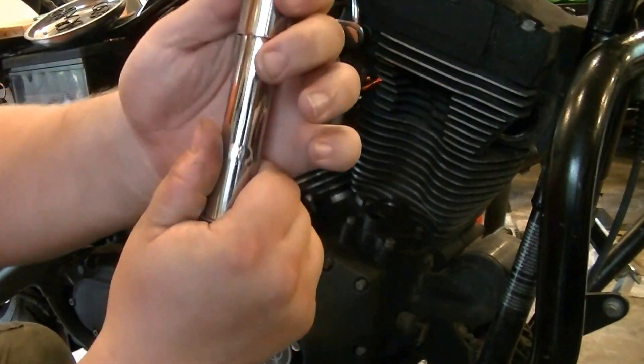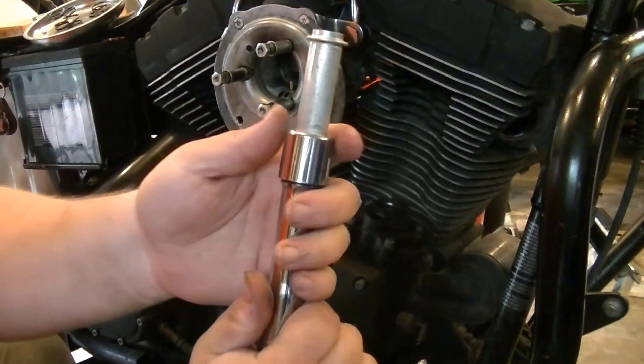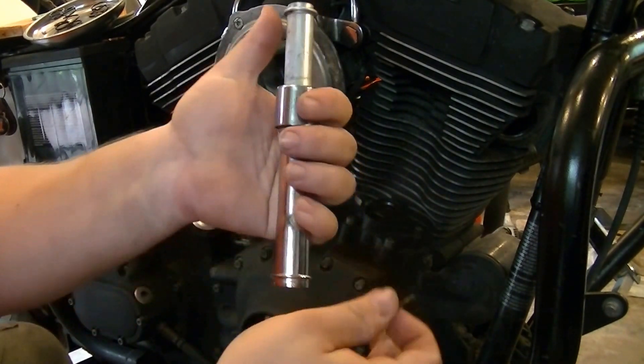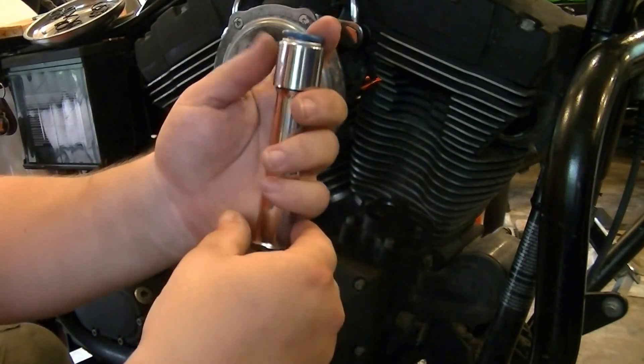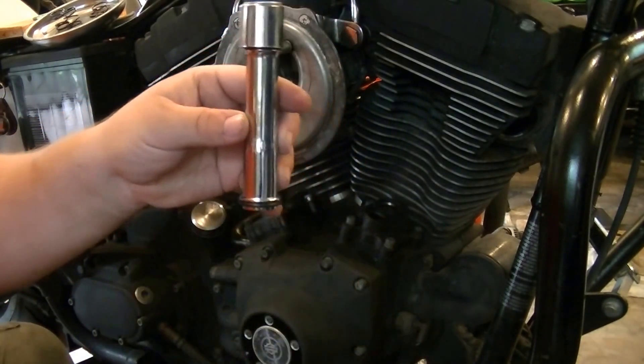Being able to pull it down — your lock tab will cover the rest of the aluminum tube and your push rod will be all seated inside. You may have to push that down and collapse it completely. Big O-ring on the bottom, little fat O-ring on the top. Now this push rod tube is ready for a push rod.